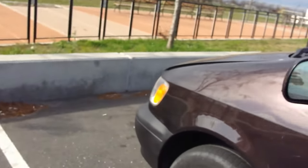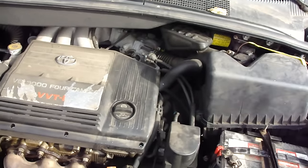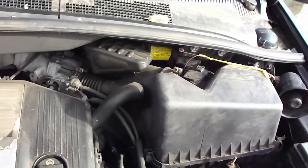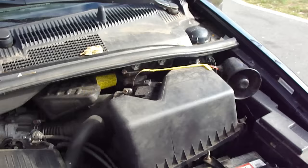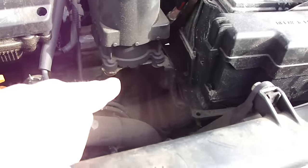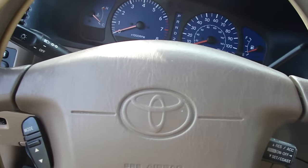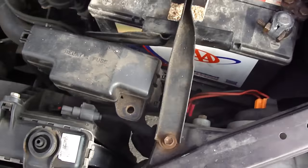We open the hood — this is a little beat-up car, got it as a trade-in, but it has a lot of potential and low miles. What I have to do is take the battery off, and I believe I'll have to take the airbox off. The sensor should be on top of the transmission. I have to turn the car off now and let it cool down because it's gonna be hot.